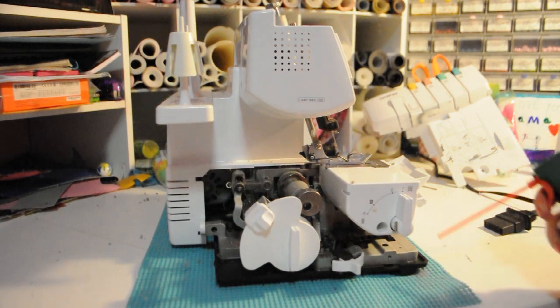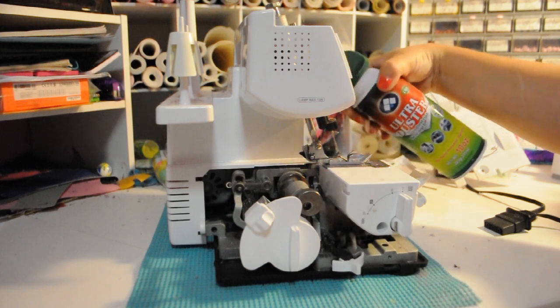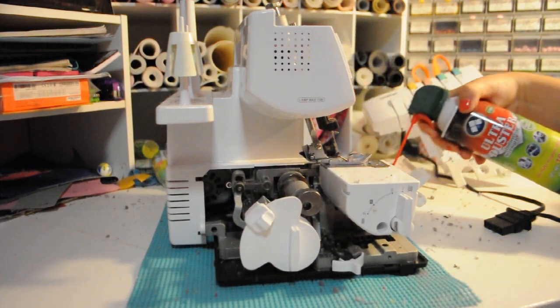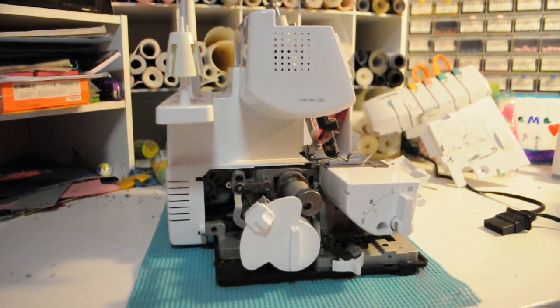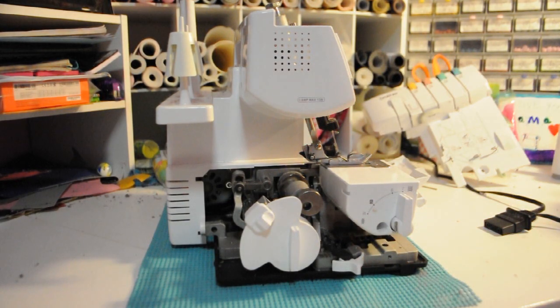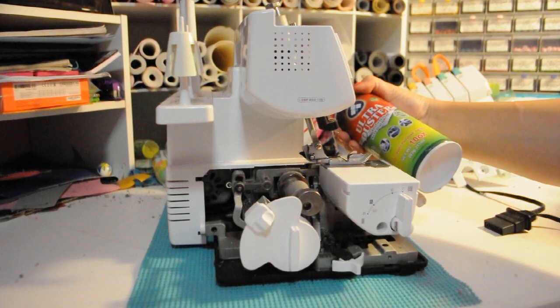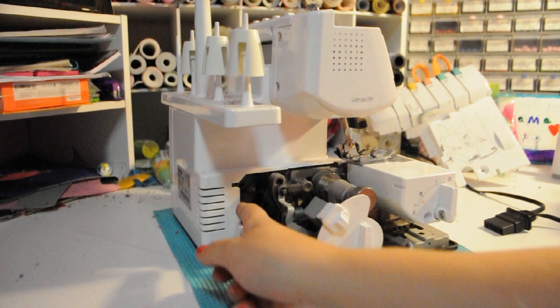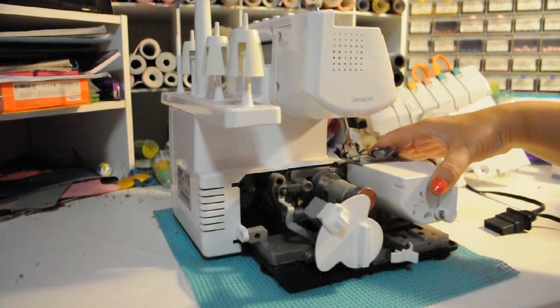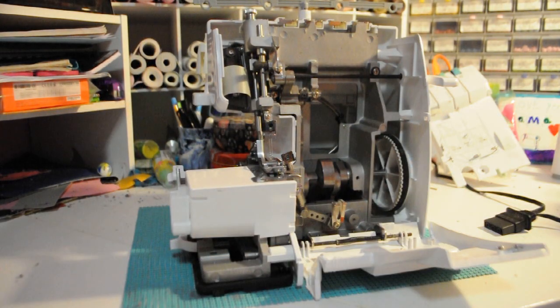From this point, you can get all the little lint out — come in from the top, from the front. This is the only time I would recommend using canned air, because I have it completely open. Before I put it together, I will blow the engine compartment out completely to make sure I didn't lodge any lint in the engine itself. So that's the most important part. We have cleaned the machine and we have fixed the timing, and at this point I'm just going to put everything back on.